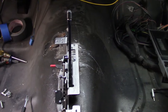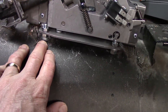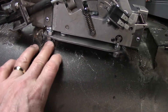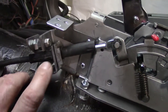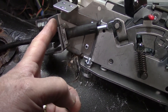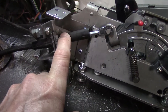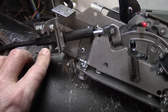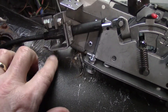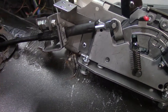Let me swing around and get the cable in. There is the cable bolted up. I had to use a couple of washers and a nut large enough to slip on the bolt to hold it in and keep this level for the center console. This bolt hole here would usually be wedged right here and bolted on, with the whole bracket in front. The Camaro/Firebird shifter cable apparently doesn't have this length, so the workaround was a set of bolts as a spacer, and a long enough bolt and nut to hold the thing in place. Open up the back end, open up the notch on the shifter, cable goes in, put your clip in — everything is in order.